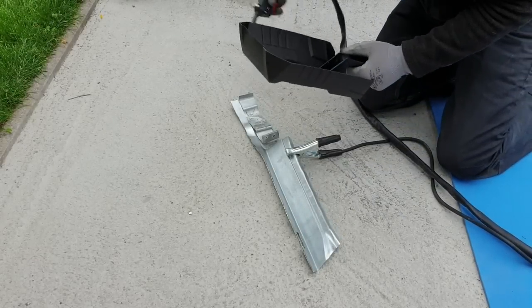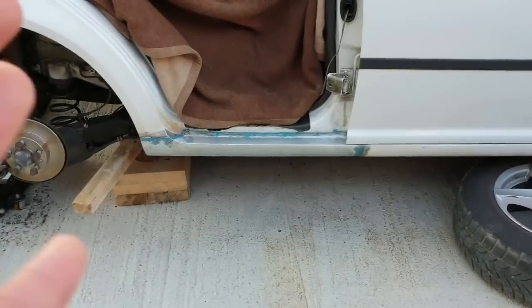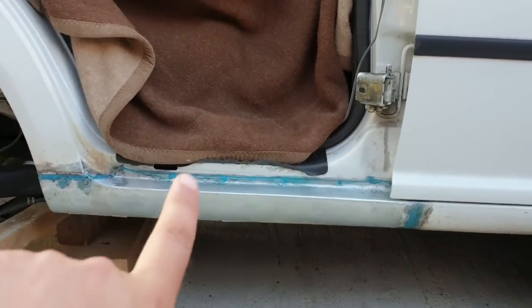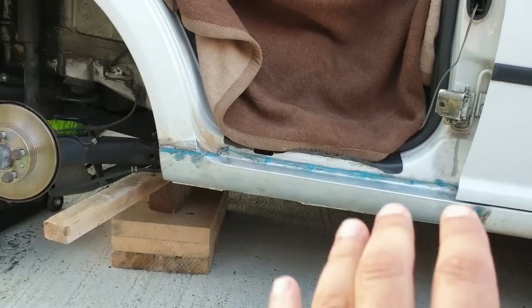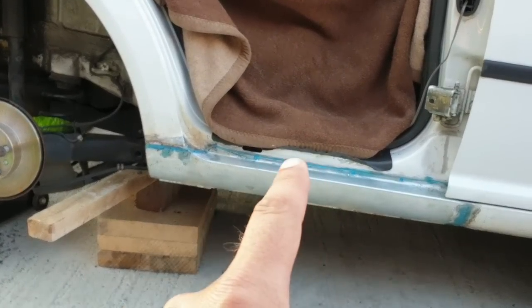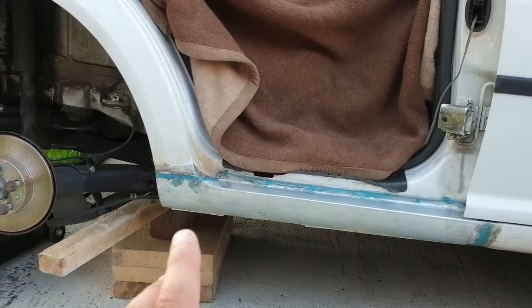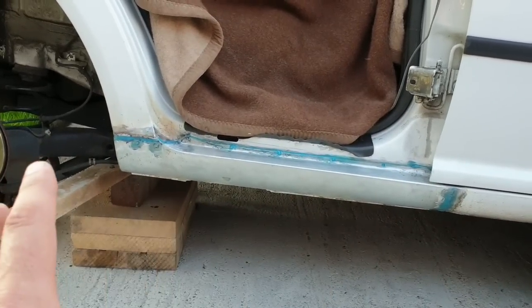Practice time. And it's done, boys. As you can see in there, the welding points. And this blue, it's industrial glue. It's exactly what the manufacturers are using these days to glue the panels in order to weld the panels. So I've put this glue just to fill the welding holes and all the edges. And I have to leave it like this till tomorrow, and then I can sand this, use some Bondo and put some primer in there.